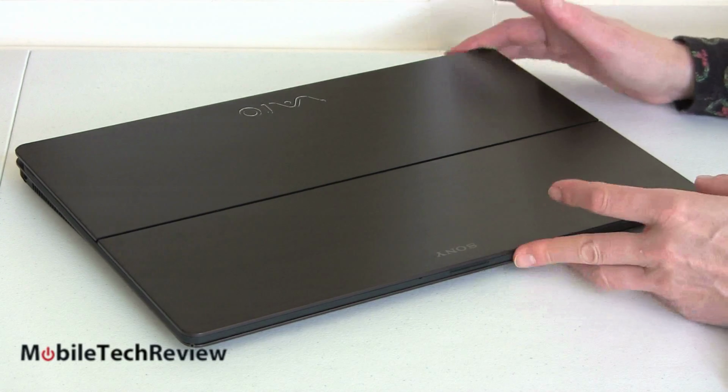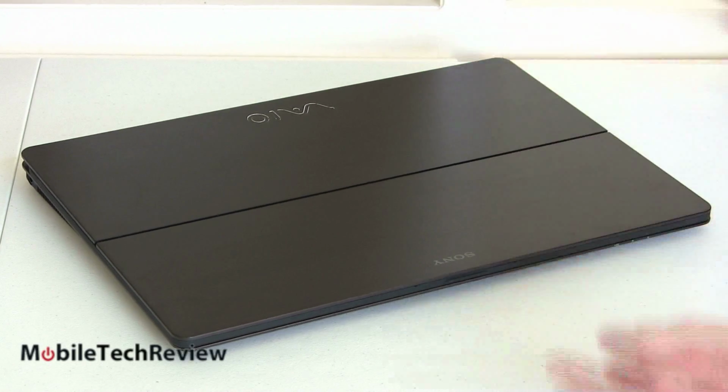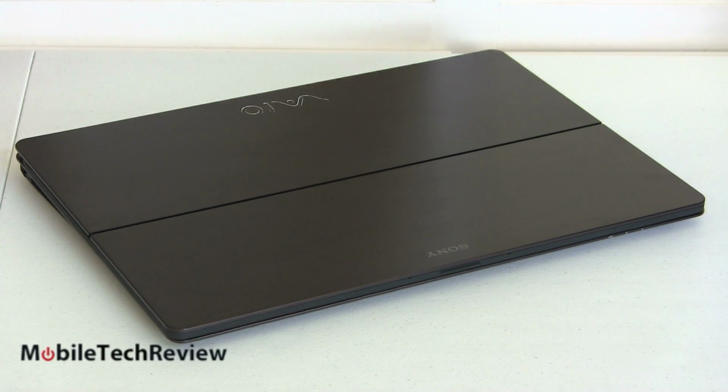Battery life on this guy, this is the price you pay for something that is slim and made as relatively light as possible. Sony claims 5-hour run times. I find that they're actually being a little bit shy there because we've managed to exceed that already. Of course, going to Windows 8.1, this one shipped with Windows 8, actually helped. Windows 8.1 does further improve battery life, and Haswell Ultrabook CPUs are power efficient. When using this with dedicated graphics not engaged, the NVIDIA Optimus handles that, doing productivity kind of work and streaming video where Intel HD 4400 is more than capable enough. Really, I managed 5.5, sometimes even 6 hours with this, and that's with the brightness set at about 35%, which is as low as I would personally want to go on this display. If you do a mix of more demanding tasks, I would count on that 5 that Sony promises from the 48 watt-hour, 3170 milliamp battery that is sealed inside, though if you take those screws off, you do have access to the battery inside.